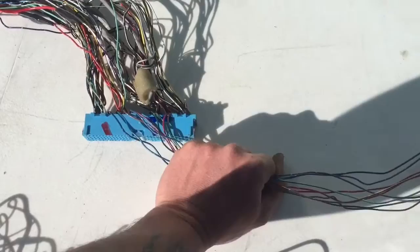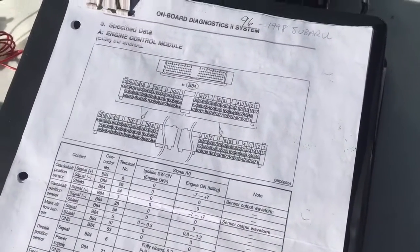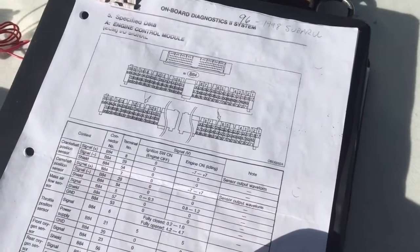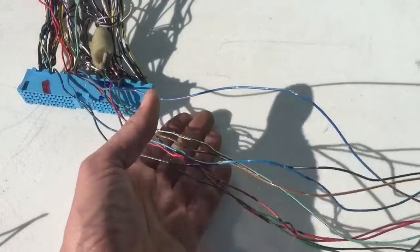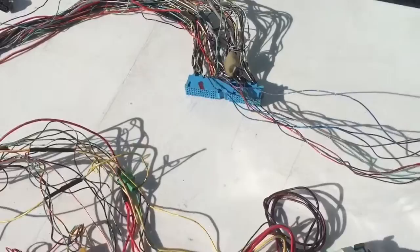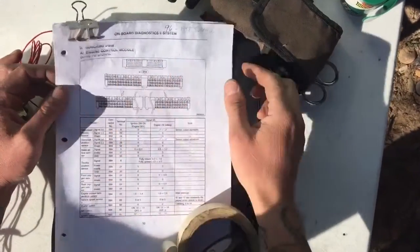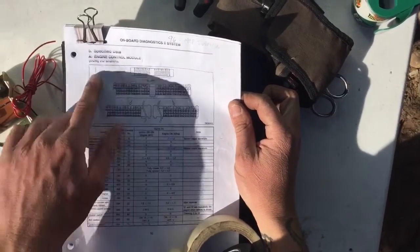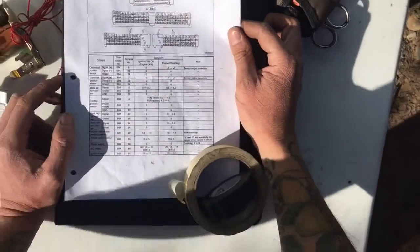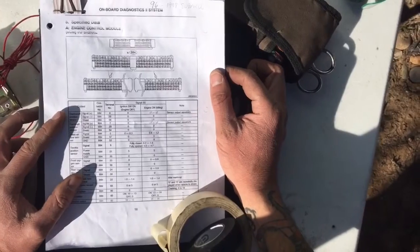We're going to jump in here and take a look at the ECU pinout and identify these guys first, then we're going to go down the ECU chart. Get yourself one of these from one of the links I provide. Normally I don't do that when I'm doing a harness, but we're just going to do that for clarity's sake. Go ahead and print this out — it's an ECU pinout IO signal sheet, and that stands for input/output signal. The link will be in the description to where you can get this sheet for your year and model.